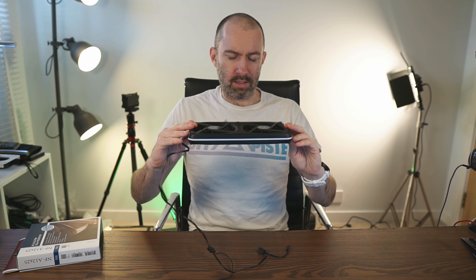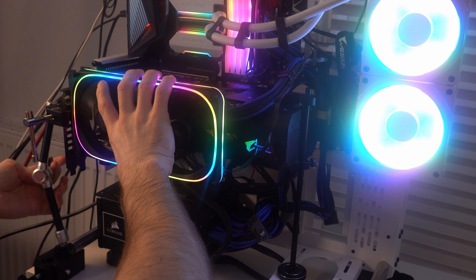I replied to all comments in that video, but I want to clarify one point. Someone asked why I was using push rather than pull — referring to whether air was flowing into the GPU or being exhausted away from it. I tested both push and pull in today's experiments as well, and I have not seen any difference between setting these fans as intake or exhaust. Even when I cranked them up to 2000 RPM, push and pull didn't make a significant difference — though your results may vary depending on your PC setup.